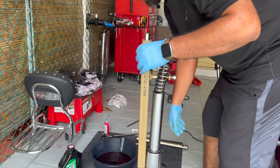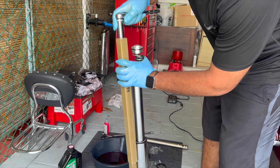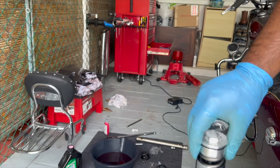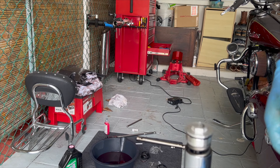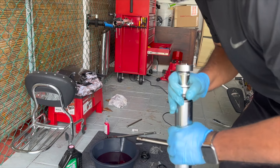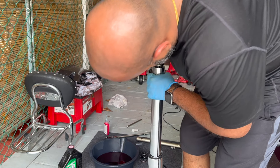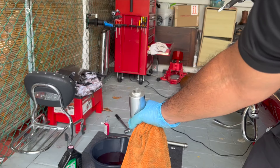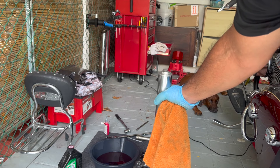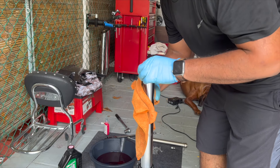Now you can release the tension on the spring. Now that this has been torqued, we just need to thread the fork cap into the inner tube. This palm ratchet with the same 22mm socket comes in handy here — you need some force. Make sure the inner tube is fully extended, push down until you feel the threads lock in. I managed to get it in — it's hard to torque right now, but we'll torque it after putting it in the triple clamp, where the torque spec is 16 foot-pounds for the fork cap.